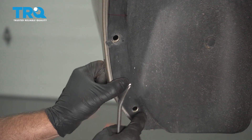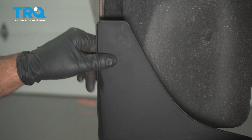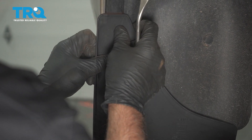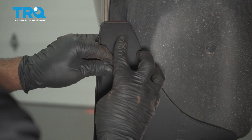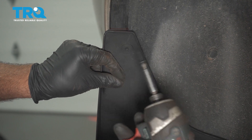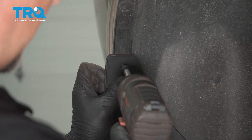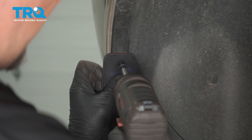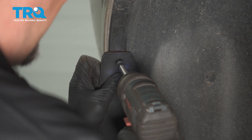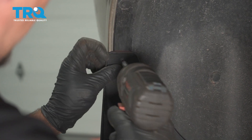You want to get this lined up the way it's supposed to be. Take the mud flap and line that up. Then we're gonna take a screw that comes with the hardware and use a Phillips head bit to get this started right there. Screw that in — just snug.